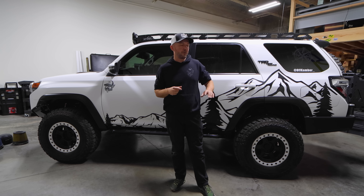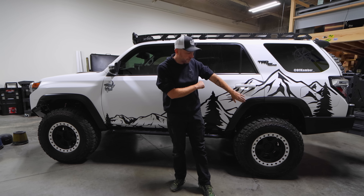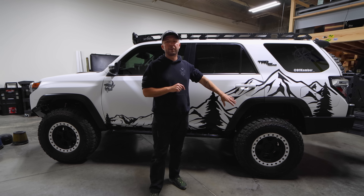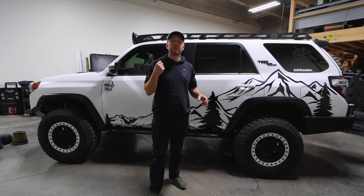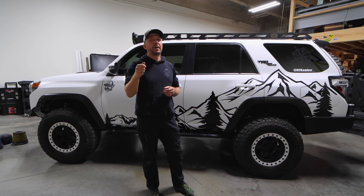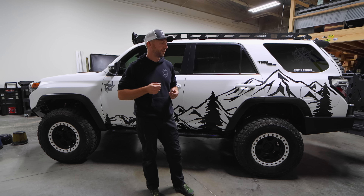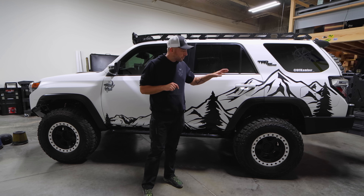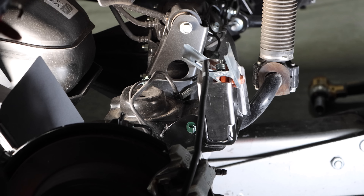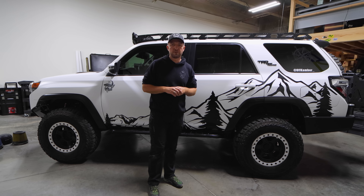For the rear, all four links are replaced because I wanted to push the axle back about half an inch for good clearance on the 34-inch tires and to get the right driveshaft angle. I also have an adjustable panhard — all the links and panhard are from Rockman. I also have a rear panhard relocation bracket. After I welded on my bracket, I realized I didn't actually need the adjustable panhard bar — the stock one would have been close enough. So I just recommend getting the bracket, not necessarily the adjustable panhard bar.